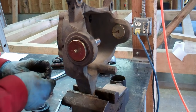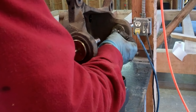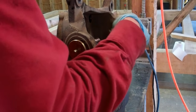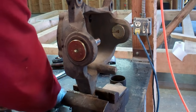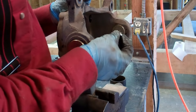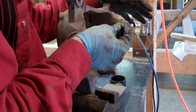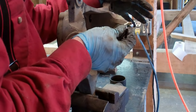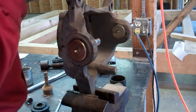Now what I realized on the other one, you can see right here it came with a little elbowed, or 90 degree, joint. I installed it, but it would not clear the drive axle, the front axle. There was a conflict there, and I didn't realize that in time. I didn't read the instructions, but it came with a small cap, and so we'll put that in here instead to seal that hole. The instructions said, well, yeah, just spin this back in there when it's time to service the ball joint. And I thought, yeah, right, like that's gonna happen. But I'll throw them in the glove box, so I guess if it's not too much trouble to get to when I do that, I can screw it in, put some grease in there, and then take it back out, replace the plug. But realistically, I don't see that happening.